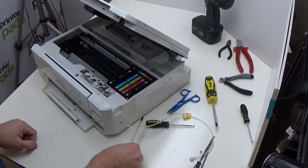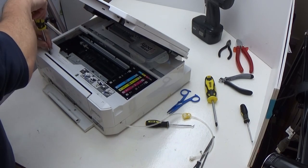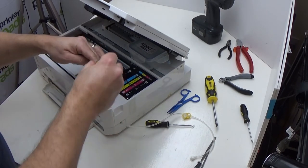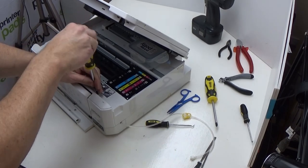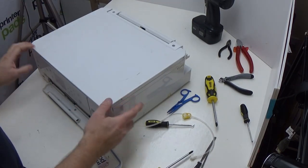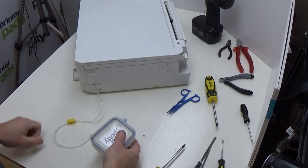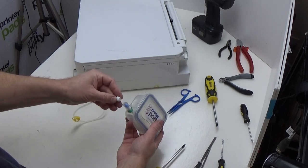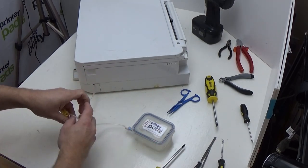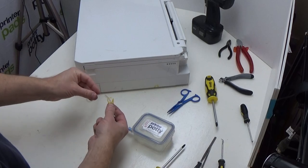Then we put our two screws back in as we removed them — one here and one there. Remove whatever was wedging the lid open and close it. Make sure our lid is on our tank with the vent hole towards the valve, and then screw the connecting piece onto the valve and that will open the valve up automatically. Last thing to do: make sure your tube clamp is open — if it's closed no waste ink will get through. Do it like that — that's open, that's good.